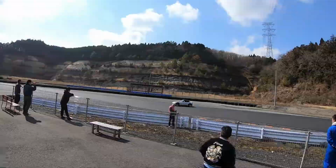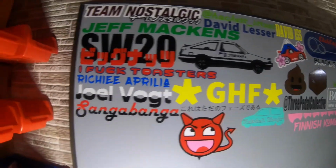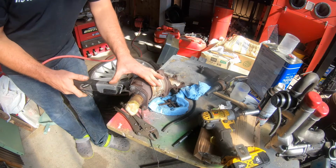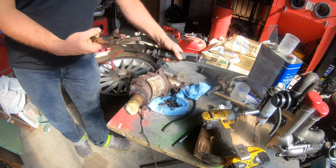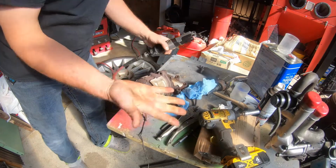And it looks like it's going to have to be modified straight out of the packet, so what's unusual about that? Here you'll see that the nut is completely rusted on, so I cut the end of the thread off with the air saw, and you'll also see that I can't get this nut off with vice grips because it's already been rounded off by somebody else.